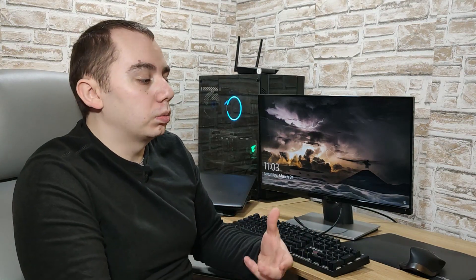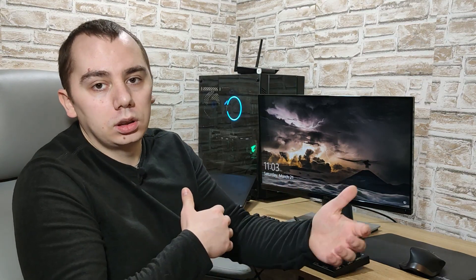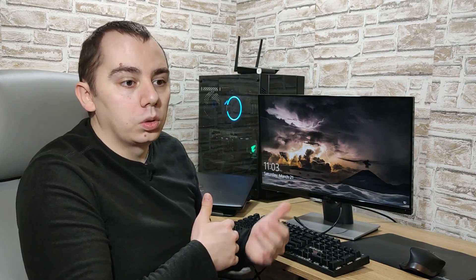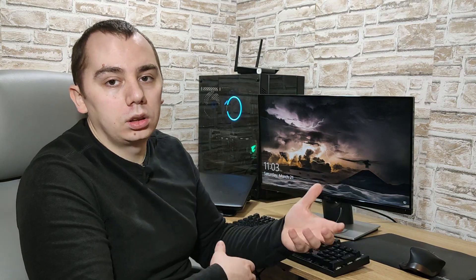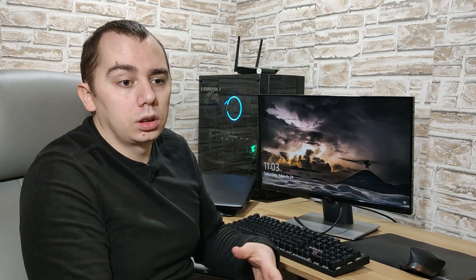While you're doing this, also monitor your temperature. You'll be surprised to see that you shave a couple of degrees off your CPU's highest temperature while gaming. I noticed that from under a minute on stock cooling, I went to almost three minutes until I hit 65 degrees in OCCT after applying a bit of undervolt. A cooler system, in some scenarios, is a more performant system — though we're not talking about an amazing boost, it's free performance that costs you zero pennies.